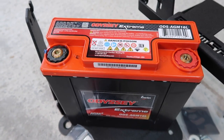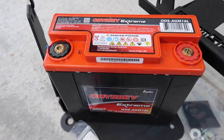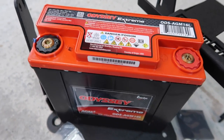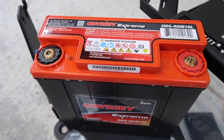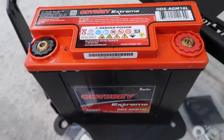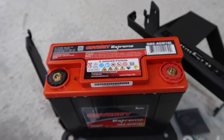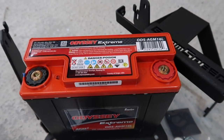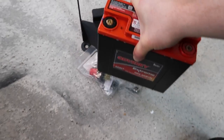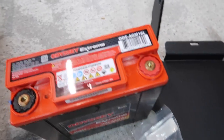It has really tightly packed pure lead plates which protect it against shock and vibration, which can quickly destroy regular batteries. So if you're really going hard on track, it won't destroy itself. Another advantage of the pure lead plates: they have twice the power overall and three times the life of conventional batteries. This battery will last longer than the regular battery, but also means we get it in this smaller form factor — and we get lighter weight for the same kind of power. As I'm holding the camera, I can easily lift this up and down with one hand, which I definitely could not do with the stock RS battery.